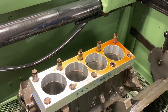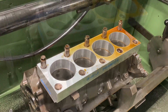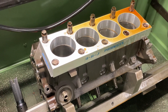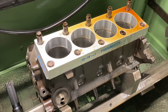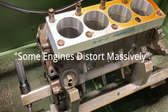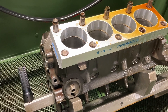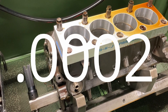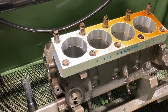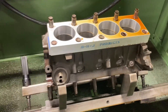Two tenths — which is definitely not worth a torque plate. There you go. I do hear often that you have to have a torque plate, but they've never actually checked it. They just repeat what they heard on the internet or what they read in Hot Rod Magazine. Because some engines are that way — some engines do distort massively — but the big block Mopar and the 351 Windsor using stock head bolts does not. It distorted two tenths of a thousandths; that's near zero. Awesome.